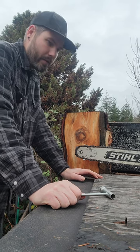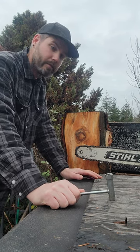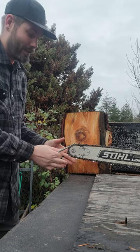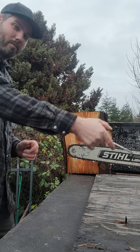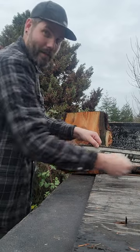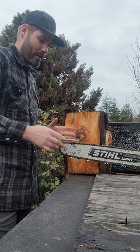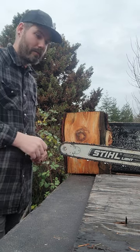Many scenarios have professional cutters doing things that are against the book, but they have to be done — that's the life of a cutter. But if this tip is exposed to thin air, there is no way it will kick back in a downward pulling cut. The chain is pulling against the saw when you're bottom-bar cutting — it's sucking itself into the wood. It physically cannot launch out of there when the tip is exposed to thin air.